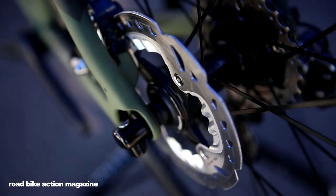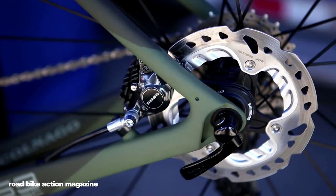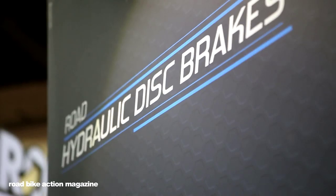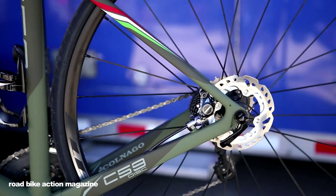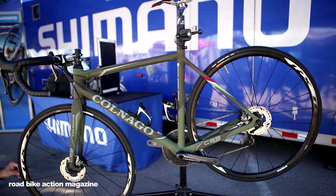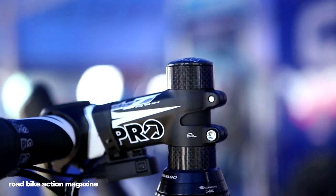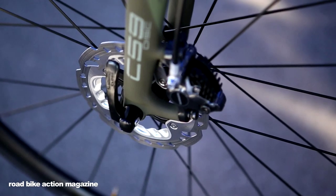Shimano ICE Technologies is unique in this system in that it's been used in top competition by our mountain bike athletes for our gravity component groups all the way down to cross-country racing groups. ICE Technology uses aluminum as a heat-reducing agent. It's used by being sandwiched in the disc rotor to reduce heat as it rotates, and also in special aluminum-finned disc brake pads inside the disc caliper. We've had ICE Technologies used for several years on the mountain side, now adapted for road, as heat in disc brake systems can be a challenge.